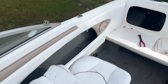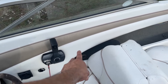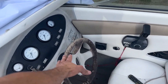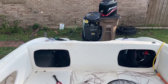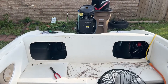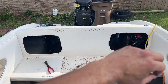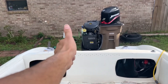If this helped anybody out: if you can't figure it out, you can do it that way — just make sure the blue and green wires are connected to the motor and it will go up and down. It relieves a whole bunch of headache, and if it ever goes bad you just check the fuses. Tomorrow I might put it on the water since the trim works now and I've got gas in it. Give me a like, comment below if you know what the problem was. This was part four — trim, gas sending unit, and battery all done.